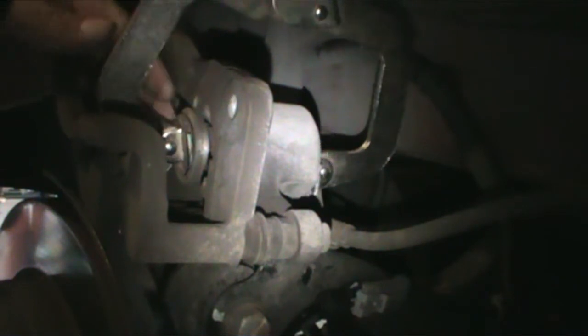Alright, so I got the brake fluid reservoir cap open completely. I'm going to be putting mild pressure to the piston to get it to go in for the new pads. I'll be using lovely channel locks. Pushing them in now. May have to go get my other set, or my brake set. Reason being is I need to make sure I push this piston in straight.